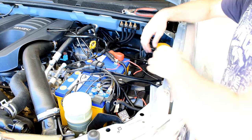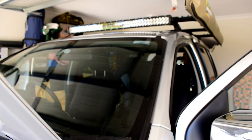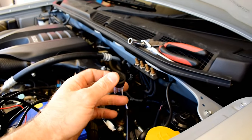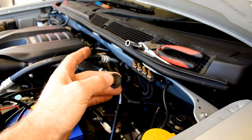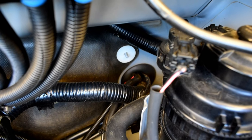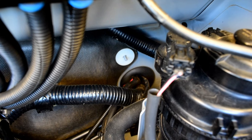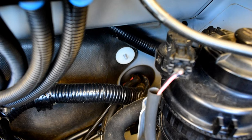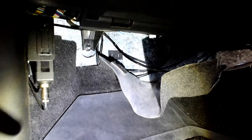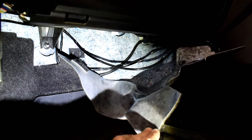Now I've wired it up and I just need to check that it works. I'll flick my high beams on, flick my switch on, and now the light bar works. Now we've modified the wiring harness so it works off the high beams, but you can also activate it on and off by the switch. Now we can run the wiring into the vehicle. This is the grommet I'm going to use to run the wiring through the firewall — I've used it for a few other wiring harnesses, for my other spotlights and my locker, so it already has a little gash in it. You just put a slit in it with a razor blade and push your wiring through.